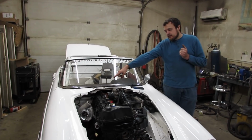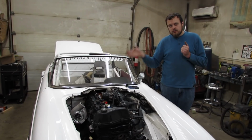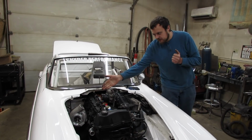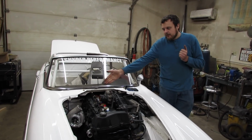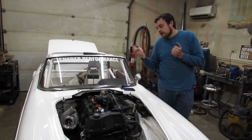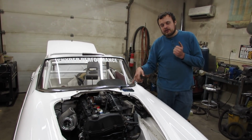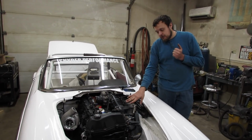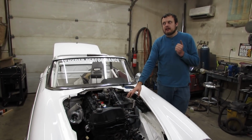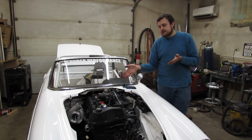It's a GT3582. Instead of the 77mm turbine, it has a 62mm turbine. What has been found with these turbos is the compressor will outflow the exhaust much sooner than a GT45. So we're in a case where we're going to see more back pressure in the exhaust than we are going to see boost pressure. And therefore, we may find that the variable valve timing needs to be in a less retarded position than maybe what it likes naturally aspirating.